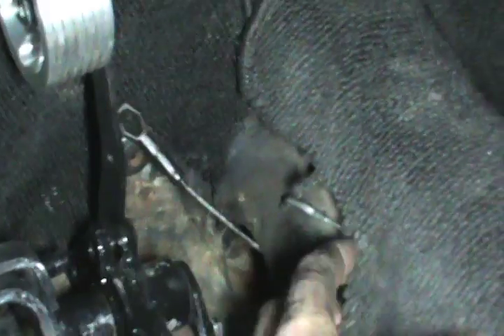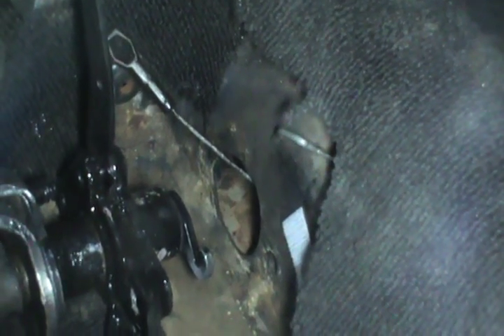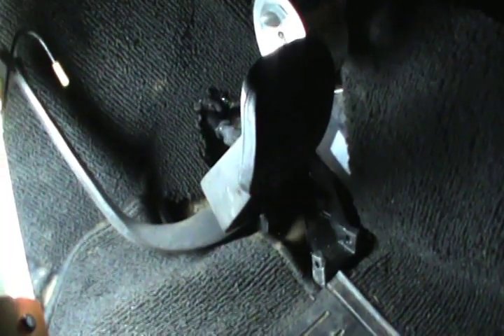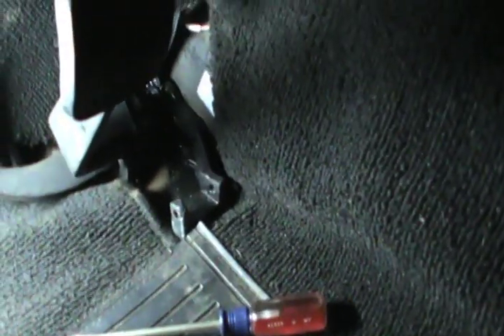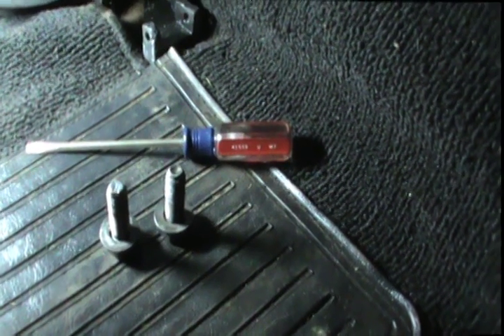This is not going to be hanging up on us anymore. It takes a little bit of time but it's all worth it. We also need to get our throttle cable — you want to check that for frays right here. This is routine maintenance on these. It's a real drag when your accelerator cable breaks. I've got everything eased in here together. Got my clutch cable hooked up, throttle cable hooked under our new roller pedal, brakes push rod in. Got these bolts cleaned up because they always go in a lot easier. I put a thin film of anti-seize on there. I'm going to go ahead and run the bolts in.